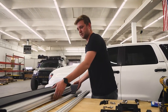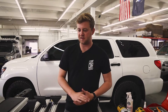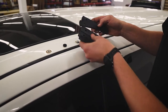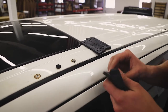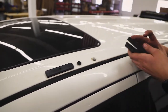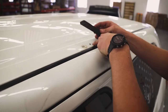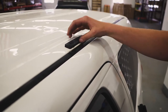Repeat this step with the next two crossbars with the middle and rear mounts. Now our mounts are all assembled onto the crossbars. Before we bring those up to the roof, we're going to grab our rubber mounting spacers and put those up first. You'll have six rubber spacers — two short ones for the front. Line up the hole with the hole in the roof and work your way down the truck. The four larger ones are not side-specific. This will cover up the hole in your roof, and the pressure of the mounting foot when bolted in will seal the other hole off.